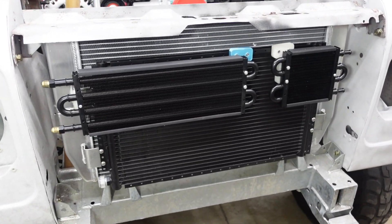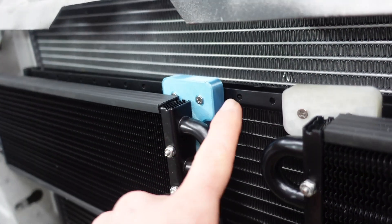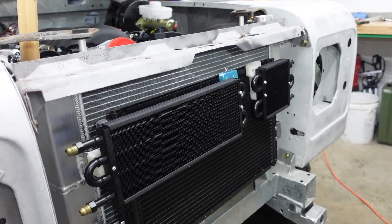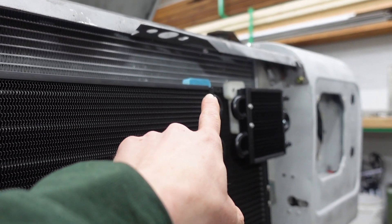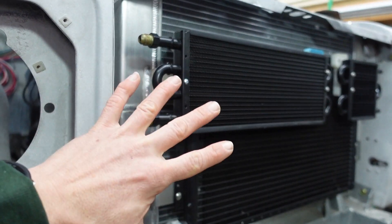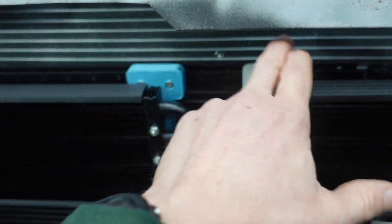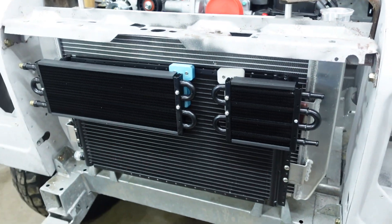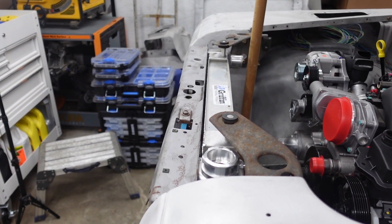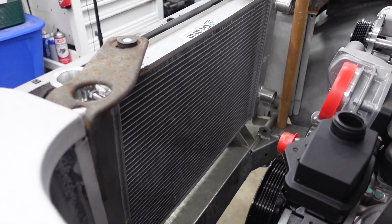There's our little solution to mount the coolers — got the little T's running through these guys and through the condenser, then a spacer through the other bracket. I like where that goes. We also have the option to flip them upside down and mount on the bottom — everything top to bottom is symmetrical. I'll slim these guys down, make them more streamlined, and print them in some black ABS. Everything's tucked underneath the radiator support, plenty of room, nothing hanging out — just need to get a fan in there and build a shroud.